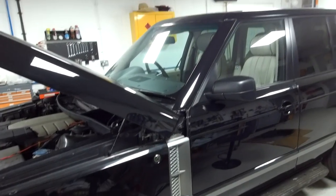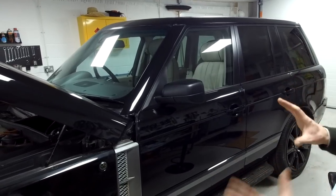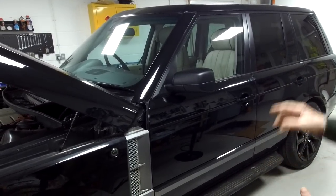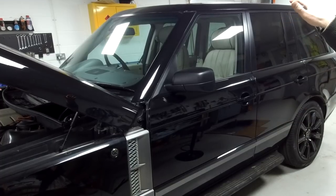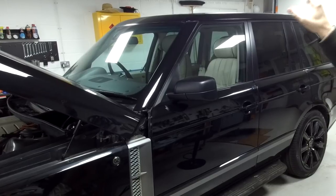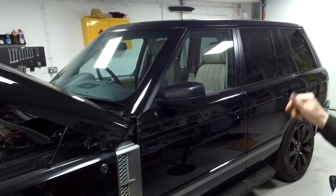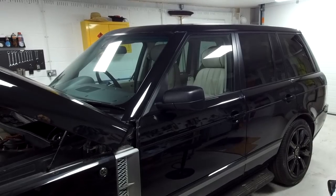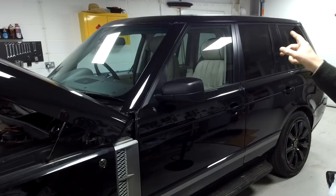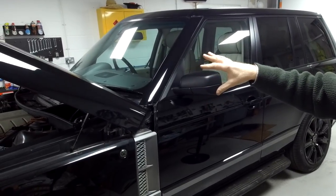Odd video today. We are going to do a bit of maintenance around water leaks, sunroof and water leaks, and the two are intrinsically linked. So we're going to jump in, recalibrate and resync the sunroof, in case anyone's sunroof isn't opening or closing, because that's one thing that will not necessarily result in water loss but isn't going to help. Then we're going to check the drain channels on the sunroof, and we're going to check the drain channels on the air intake on the front cowling.